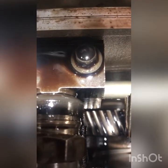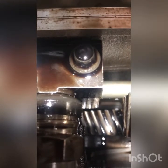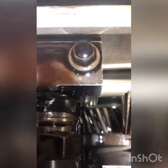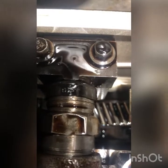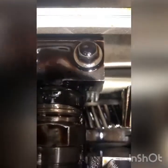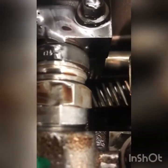You can see little oil bubbles coming out right there. This is just shop air — about 90 to 120 psi — and it's leaking right there. This pump is going to put out at least 600 psi oil pressure at startup. If you're leaking at 90 psi shop air, you're for sure going to have a leak at 600 psi when this thing's trying to start hot.